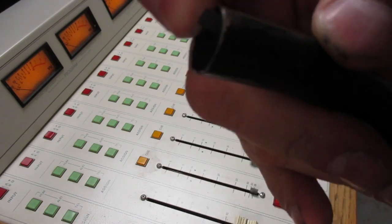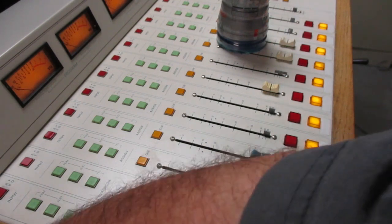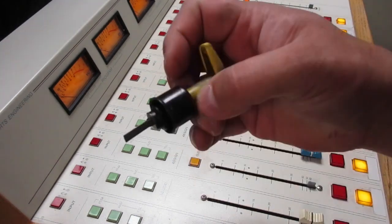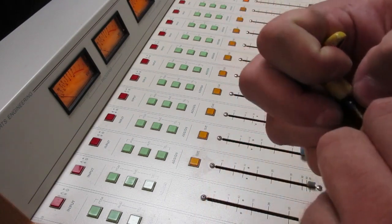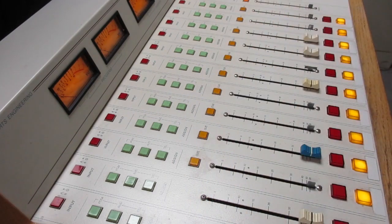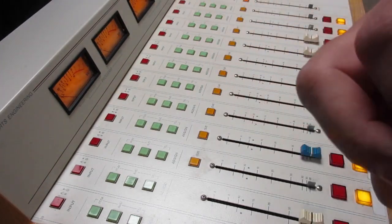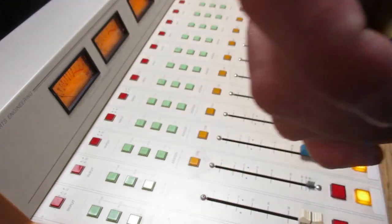And then on this end, we need to weld the dipstick together with the top piece, wherever it went. Oh, here it is. Somebody moved it. People come in here and play with things sometimes. There. So I'm going to weld this. Looks like it goes into a metal piece before it hits plastic, so it should be okay. I'm going to weld this little tab hickey onto this here. I need to cut this a little bit shorter, though. I need to cut this about half an inch shorter, and then weld them together.